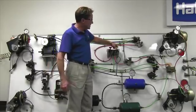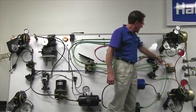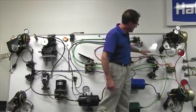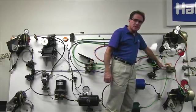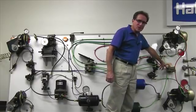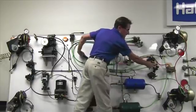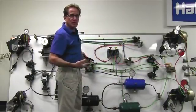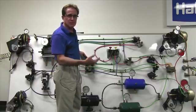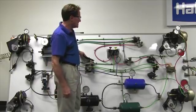So if we are parked — meaning there's no air at the control port for the spring brake release — and we apply the service brake using the foot valve and send air here, what it will do is release the parking brakes as you are applying the service relay valve. The more you apply the service brakes, the more the spring brake or parking brake is released, and it prevents compounding of the two systems.